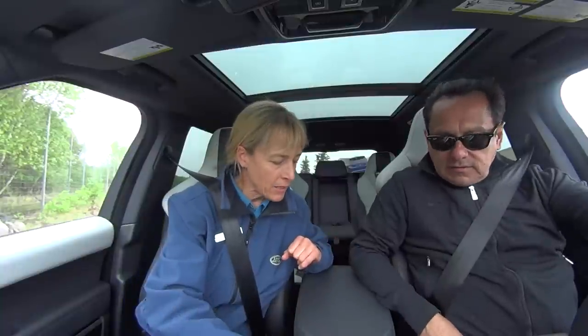We're going to take a left, then a right, then another left, and head up to the flags where the grass is. Let's stop here and go to low range. To do that we'll go into neutral — squeeze there, perfect. You'll see the little mountain icons here, so press that button. The vehicle will automatically start to raise up — you'll feel the back end comes first, then the front end. We have ground clearance already and it'll go about another five inches as we raise up.